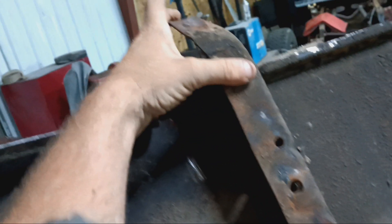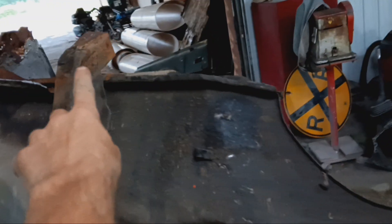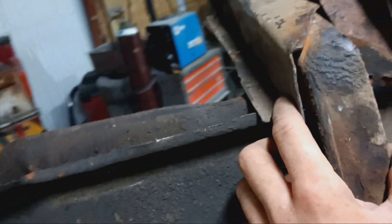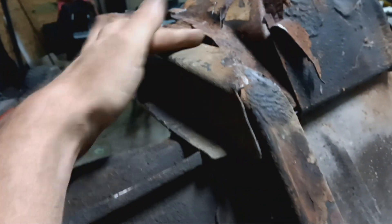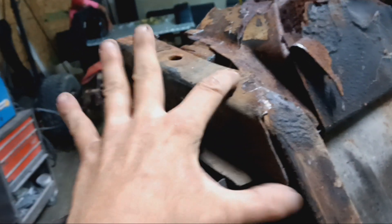Roger had a good start at getting the old front floor section pulled off. Make sure when you're pulling this apart that bracing goes all the way up in there — look how far that goes. This applies to pickups as well. Don't just cut that thing off — it goes all the way up here, and you have to section it apart carefully.